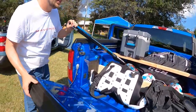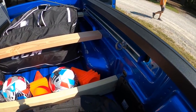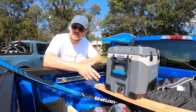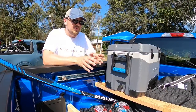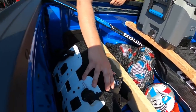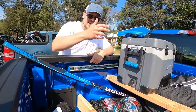This third truck shows a moment in time — taking the kids to sports practice. The customer has cut some boards to length to create a divided bed from a height perspective. You can see two-by-fours reaching across the bedsides, and a two-by-six has been cut and slid into the slot to serve as a divider. We do offer a bed divider accessory as optional content; alternatively, you can cut the two-by-six to length and just slide it in. Each of these slots and features was optimized for customer use. The cargo retained between the divider and the tailgate is within arm's reach of the fifth-percentile female, and cargo forward of the divider — balls that have escaped from the bag, et cetera — can't slide out the back when the tailgate's opened.